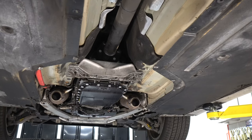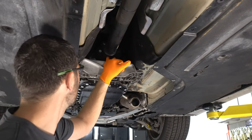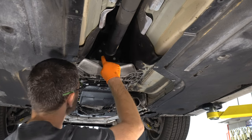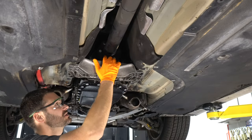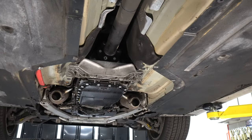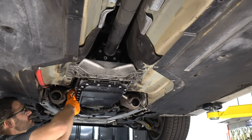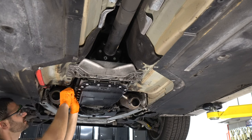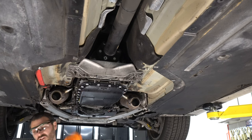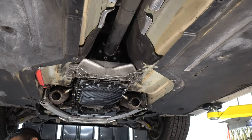Now that we've got all the heat shields off, we need to take the drive shaft out. I'm going to start by removing these three bolts here — they're 16s with probably a 16 backer. I'm going to disconnect the shifter cable so I can shift the transmission into neutral and spin the drive shaft. That's just one 13 millimeter. Looks like I've got the parking brake on.